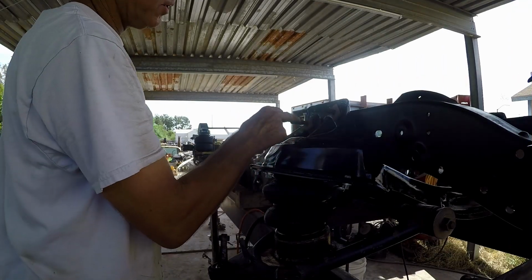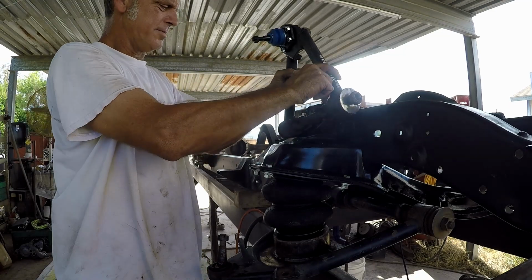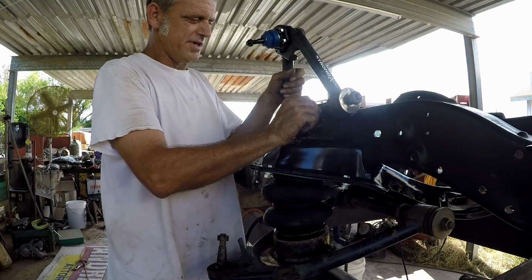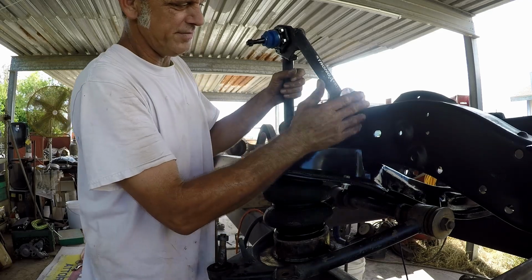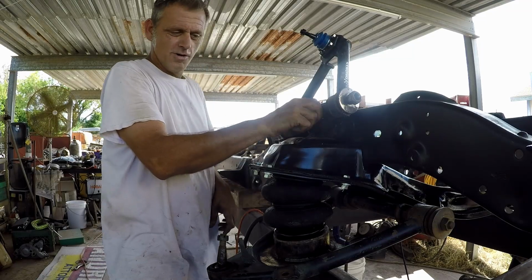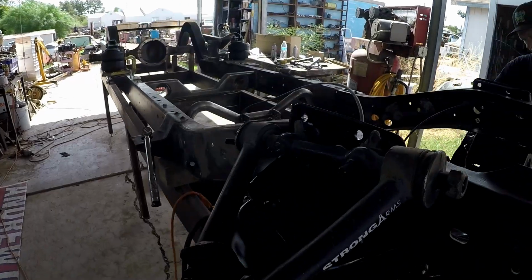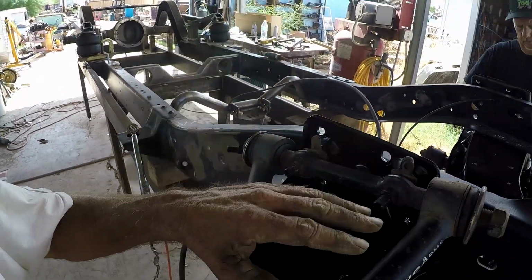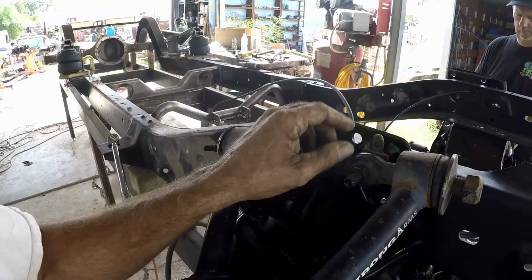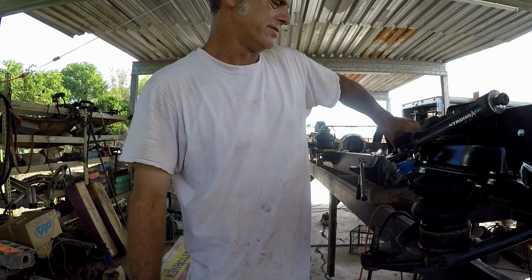We're going to put the upper control arm on. It's pretty simple, you just slip them on there. We're not worried about camber or anything quite yet. I don't know if you guys remember in previous videos where when you do bushings you leave these loose. It's because you can do this. Wow! Alright guys, so again this was just way super preliminary, but we just put 2/8 inch shims there. If you do set it up like that, you'll know how much you're off when you're putting it together.